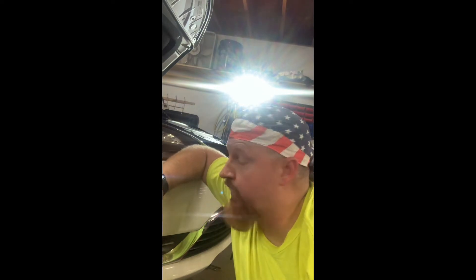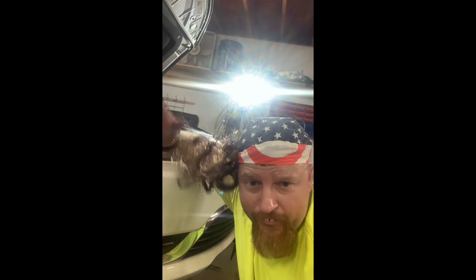It is tight under there, I'm telling you right now. Oh, Hillbilly - he starts on stuff and then he calls me and he's like, 'Hey, can you come over here and help me out, I gotta go do something.' So here I am. I got the bell housing bolts out of the bottom. The reason I do that is because when you start pulling the cooling out it just makes a mess. I like to take the bolts out of the bottom first and then pull the hood and the fluids. That's what I do.